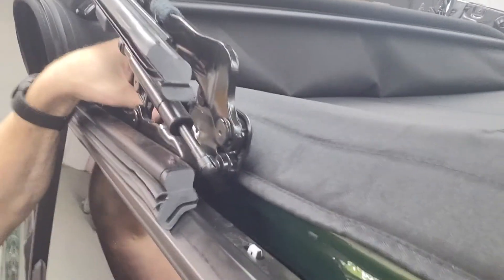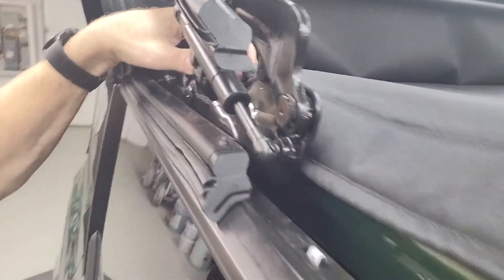After the straps, come outside and take a look around. You've got your magnetic strip here — it just holds it down. Make sure you're equally positioned on both sides. When doing it with your roof up, make sure you tuck it down because the magnets have a tendency to stick to the magnet of the frame — just make sure it gets tucked in and closed down. When closing the roof, don't slam it down — take your time, make sure the brackets aren't going to push through. We've made it as tight as possible to seal it for wintertime and keep the noise down. You can always ask us questions — give us a shout at Dirty Dog. Enjoy your soundproofing and heat warmth for the winter. Have a good day.